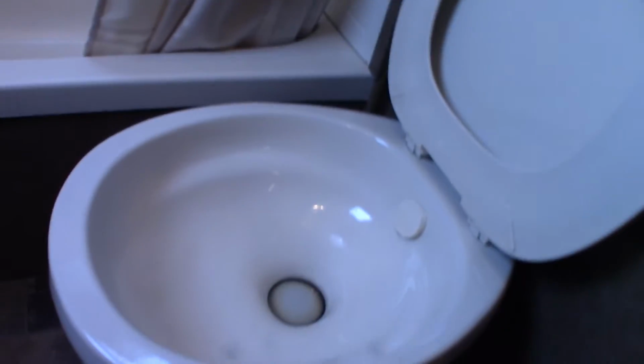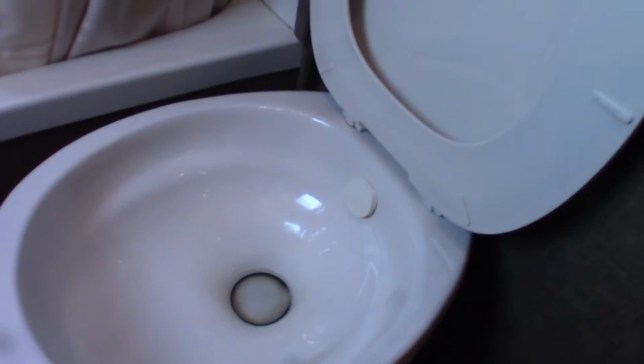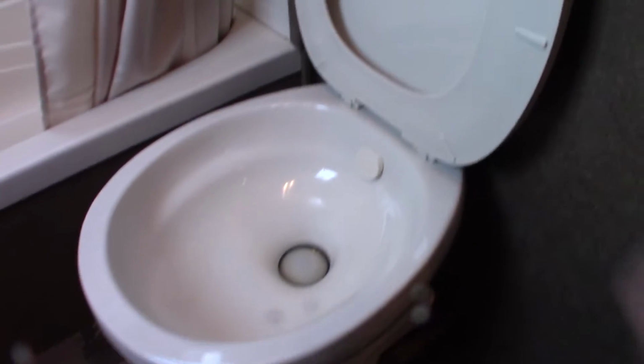You just have more storage here. Okay. And of course, the bathroom. The only thing you have to know about the bathroom, if you don't know RV toilets, is that you have to have chemical and water in it when you use it. So before you start using it, you dump a dose of chemical right in the bowl, and then you step on the pedal, water will come swirling out, and stand out long enough to put about a gallon or so of water in there. Some people use more, it's just a preference thing, but you got to have water and chemical in the black tank. The black tank is directly below before you start using it. Otherwise, the smell will be terrible, and it can get clogged up also.